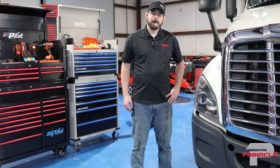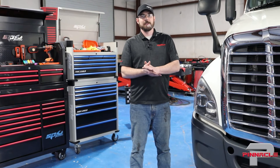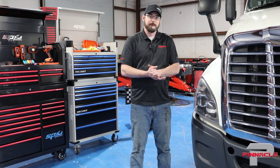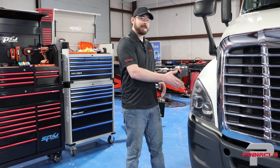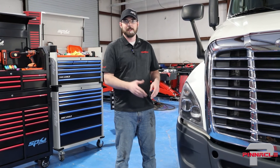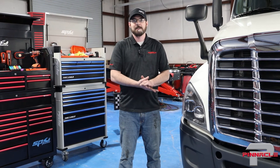We've got our new dog bone installed. I've already taken the vehicle for a test drive — no nasty pulls, no low-speed shimmies, it drove pretty well. The next step is to jack the front end up to check the kingpins and tie rod ends, and after that we're ready to get the vehicle in front of the alignment machine to get some readings and make adjustments.